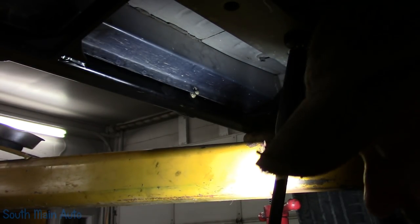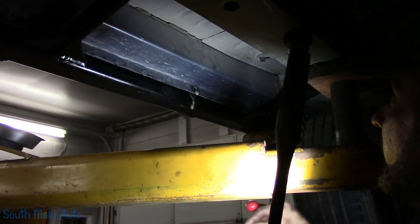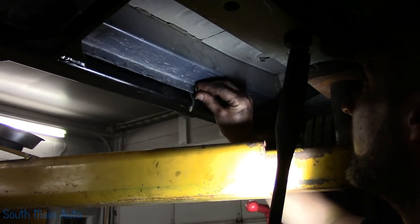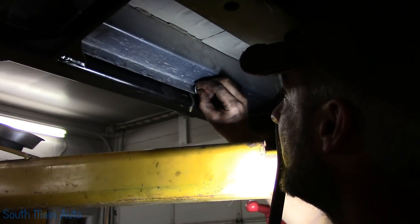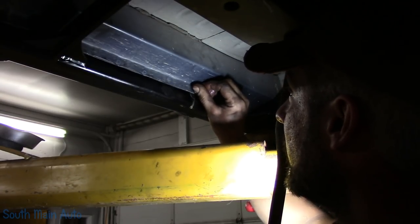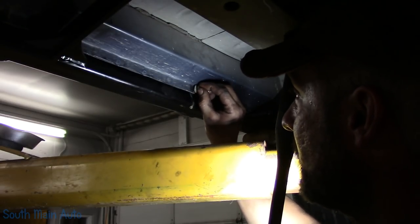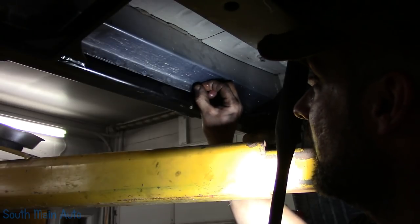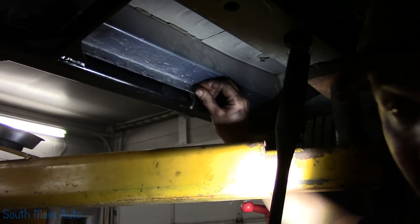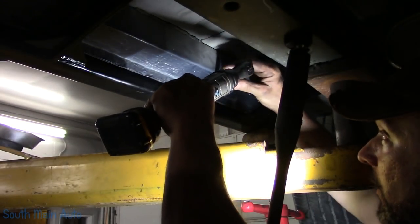I guess what I would say is, as you're going along, just leave them loose until you've got everything jockeyed around. Don't have a thread, probably should have thread chased these. If you don't have a thread chaser, maybe get a spare quarter 20 bolt prior to sticking it up. Go run it through every hole just to be sure.